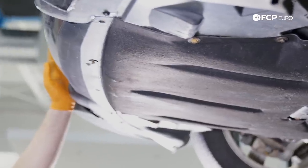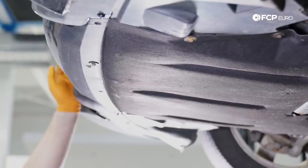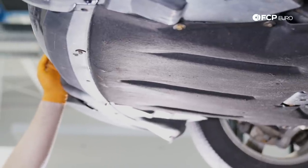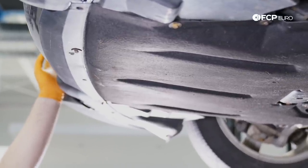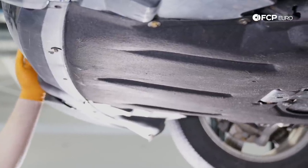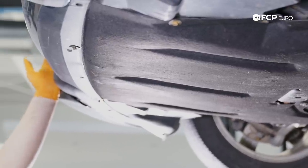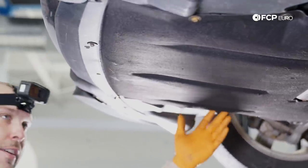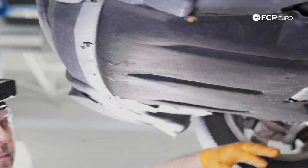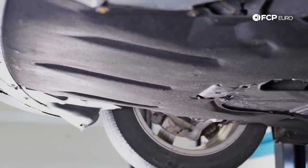So the fact of the matter is, you do have to drain coolant to prevent making a massive mess. Now, you could technically do this inside the engine bay. If you have a small enough container, you can undo one of the lines of the thermostat, but there's still going to be coolant in the oil cooler. There's still probably going to be some coolant in the upper radiator hose, and one of the things on this job that you want to avoid is dumping a whole bunch of coolant into the engine bay, especially with the electric steering rack underneath. So in my opinion, it's best to drain coolant from the inlet of the water pump and try to contain the mess as much as possible.